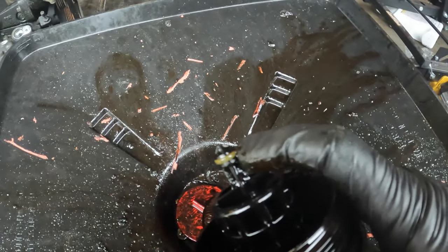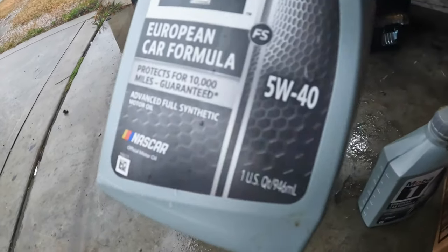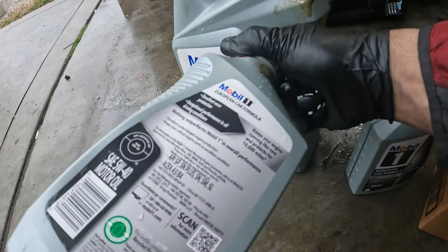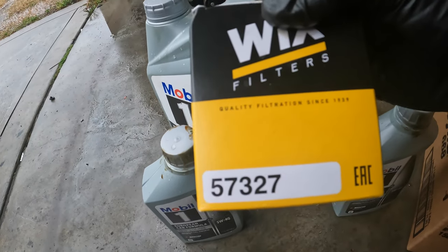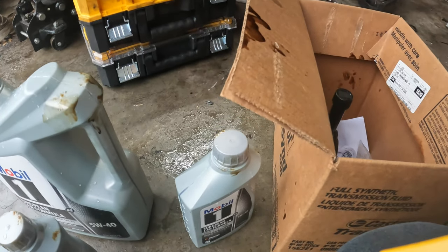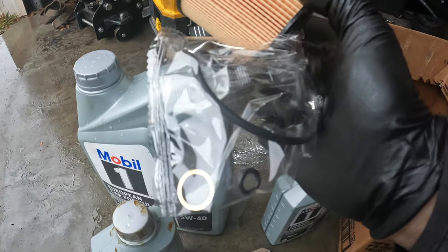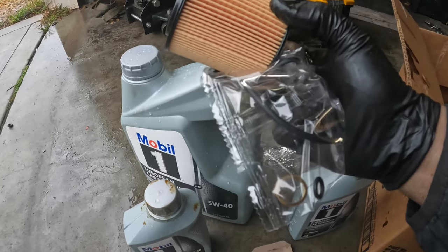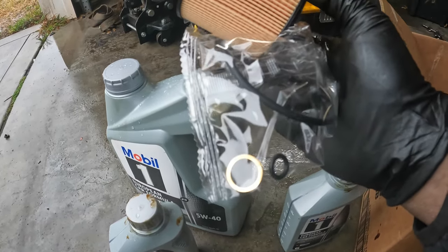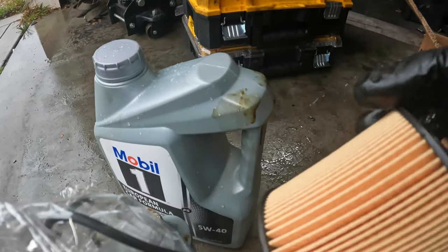There's an O-ring right there and your main O-ring on it — make sure you change those. The oil is Mobil 1 European Formula 5W-40. The filter is WIX 57327 — I wanted a Mann brand but they didn't have it in stock. These normally come with a new crush washer, but if you're doing a whole pan replacement it should come with all new hardware so you shouldn't have to worry about that. I did check to make sure the drain plug was tight.